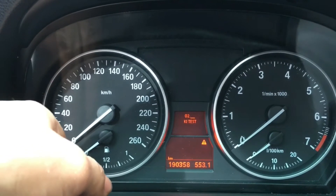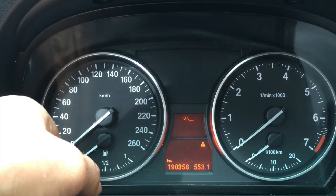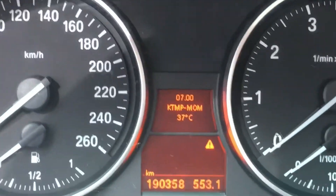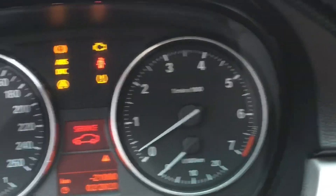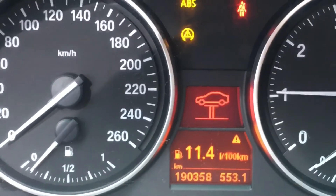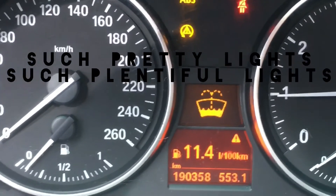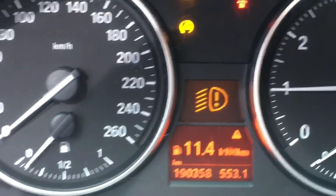We can see that the lock is off and we'll now navigate to menu number 7. Here we can see our coolant temperature has been displayed. We can now go ahead starting the vehicle, dismissing any service messages, and allowing it to get to operating temperature. Anything above about 112 degrees Celsius is most definitely cause for concern.